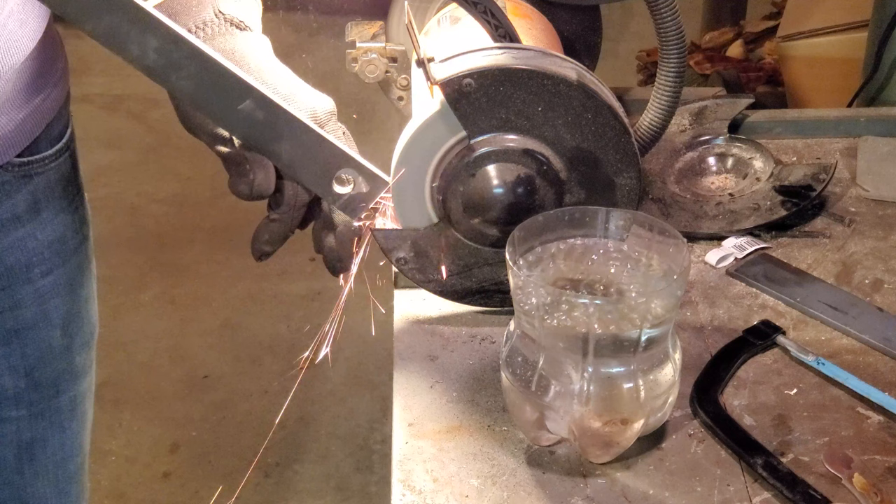Put the nut back on - that one is the 19mm, so we'll take our 19mm ratchet and wrench combination and just snug those down. This is a nylock nut, so you're going to be threading into the nylon on the nut, which makes it a little more snug than usual. Just snug that down - from there the nylon can do its job. You don't need to really reef on it. Just let the nylock do its work.